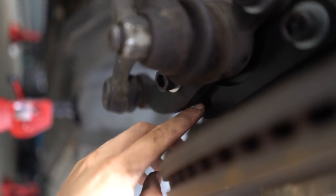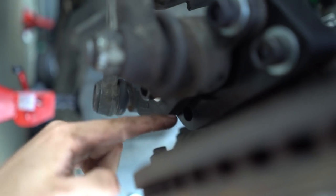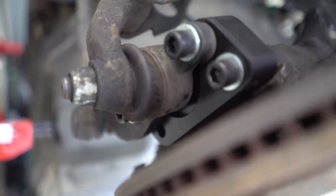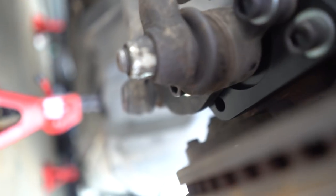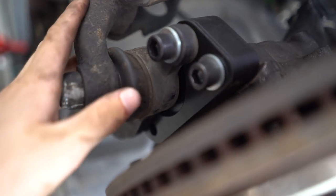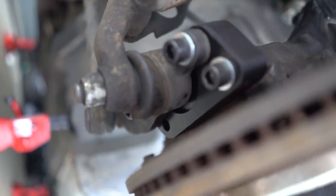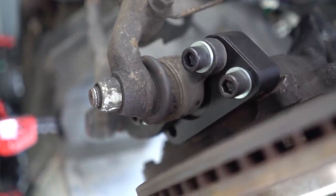I've run into a slight issue — this hole at the back appears to be too close to the ball joint mounting point, so I can't get the bolt in there, especially not with the washer. I'm asking Casey what to do about this right now. I at least have the ball in there so it's secure, and I'm going to put the wheel on, jack it up, and see if this is going to fix my issue — otherwise I can just stop right now and not continue the process.